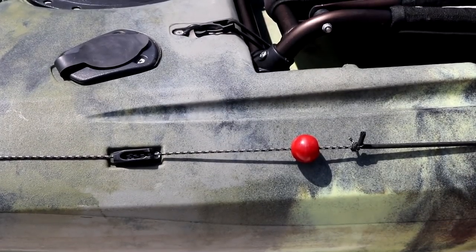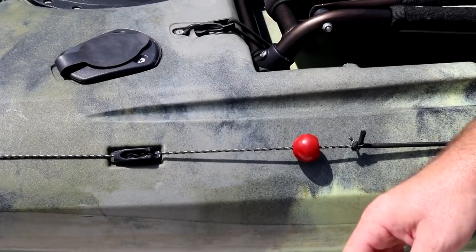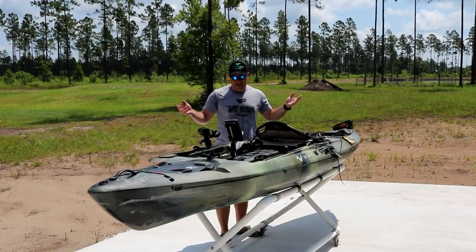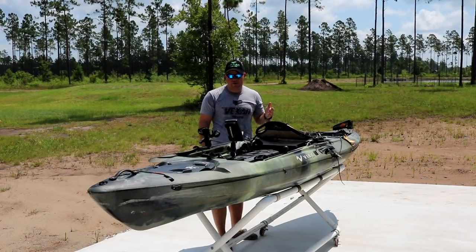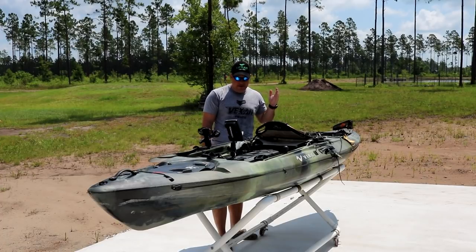That's one of the things that will fail on you when you buy this kayak. If someone has come up with a DIY fix for securing it better, please leave it in the comments. One thing I forgot to mention — this kayak has some oyster rash, scrapes from barnacles and boat ramps. If you care about aesthetics, you can use a heat gun and a plastic scraper, heat the area up, and smooth those scratches right back out. I'm more about functionality so it doesn't bother me much, but there's a tip for those who care.